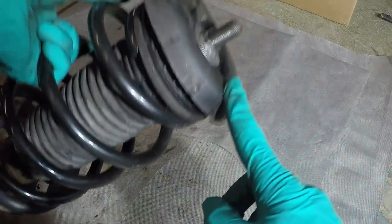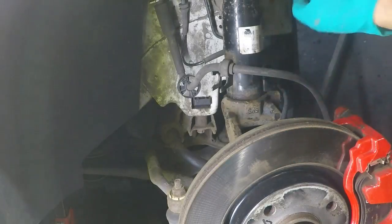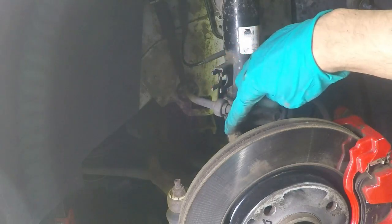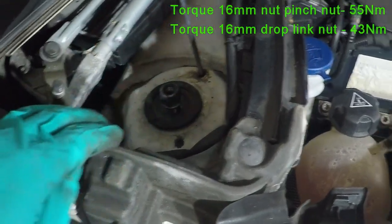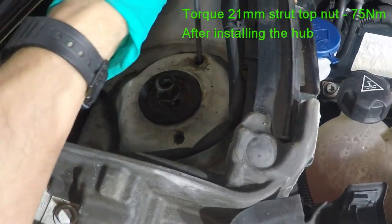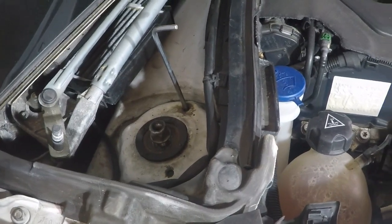So just make sure you put that plastic piece in first, then a washer, then the top mount, then the nut. I've compressed the spring with the jack underneath the hub, made sure the hub is fully up against there, and gave it a tap to make sure it's all seated correctly. Then I've tightened up the pinch bolt at the top. When I put the strut into position I put it through the hole and put the nut on so it dangled from the nut. I've got an allen key in here to make sure the top mount is in the correct alignment. When I bought the car the top mounts weren't installed properly at all - the spring had snapped from the previous owner.